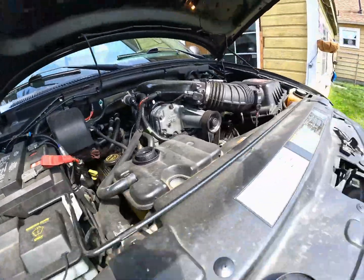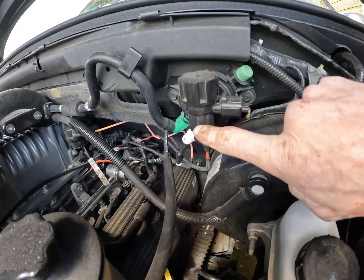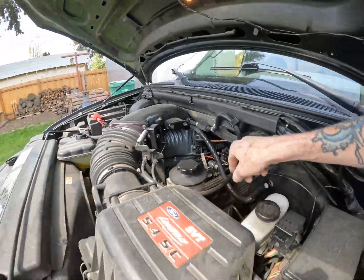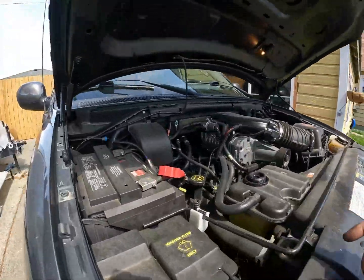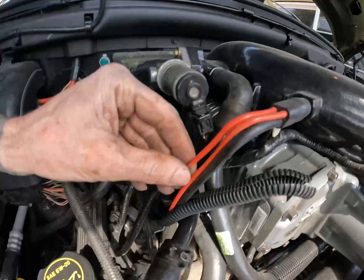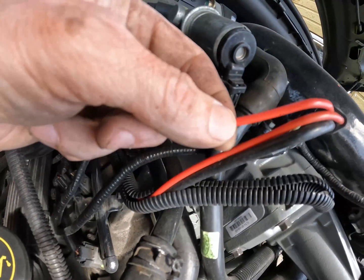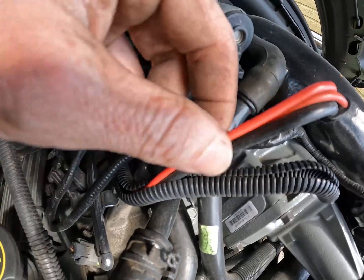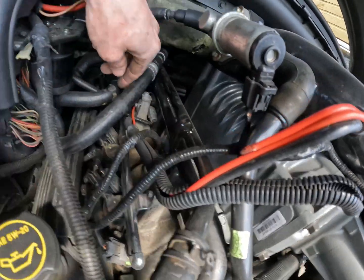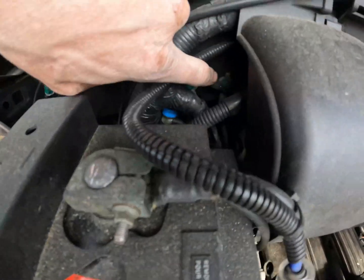As you come over here, there will be one red line coming off of this for your gas — something, I think mine's red. It goes all the way across, comes over, comes up towards the front of the engine. I burned off and closed off this line — real simple, just use a torch, get it really nice and hot, fold it over a couple times, works nice. Then you have this large black line — it comes down, makes a right, and goes over to these vacuum reserve tanks. The 3/8 line goes into the top of this.